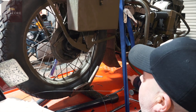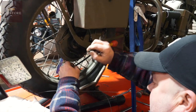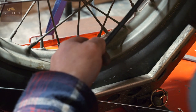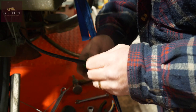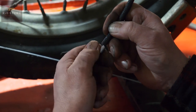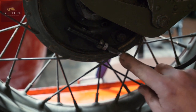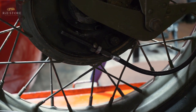Right, now we need to put our depth — that is how far that's going to go in there, so we're about there. Then you want your depth of your ferrule to be about there — let's just mark that. Then put your ferrule back on, making sure the ferrule isn't hitting that, because all it'll do is compress everything up and it won't work.